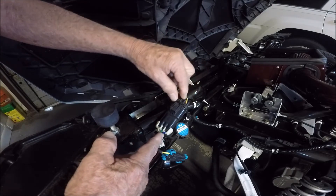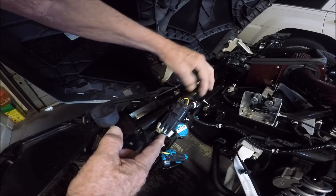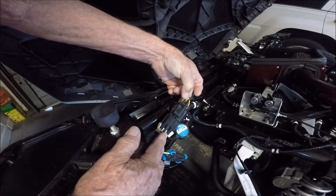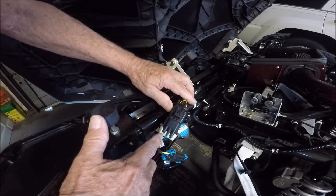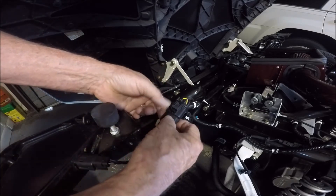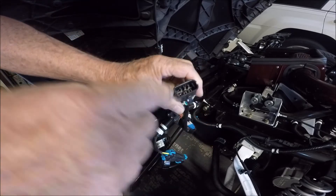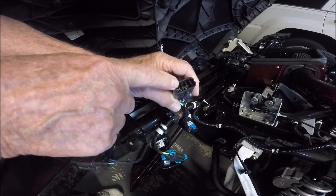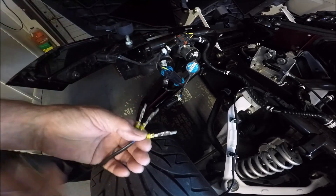You can see the blue wire here is going to the low beam side — that's yellow-pink — with ground in the center. This is the factory Slingshot wiring and this is the headlight side. The solid yellow is your high beam. So when I switch to high beam, I'm actually lighting the low beam side of the headlight. To correct this, I'll need to take this plug loose, pull the pins out, and reverse them. I have a procedure for this in my LED upgrade video.